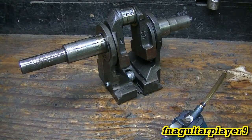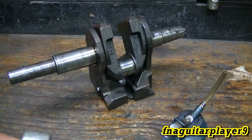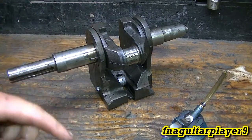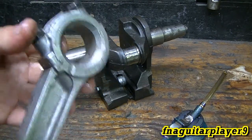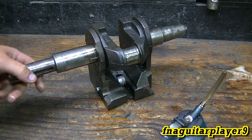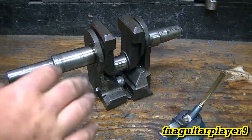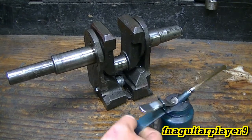You don't want any dry surfaces or moving parts. A lot of people don't know this, but when your rod is bolted on or your piston is in the cylinder, you think it's metal-on-metal contact all the time — but it's not. Your oil provides a very thin, microscopic layer that fills the surface between the rod and the crankshaft. As long as your engine has plenty of oil, you're never actually having metal-on-metal contact, because if you did, your engine wouldn't last more than a few minutes. That's why assembly lube is so important — without it, your engine starts up dry until the oil circulates, and by that time you could have spun a bearing or scored a cylinder.